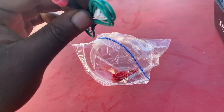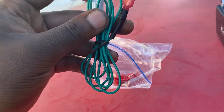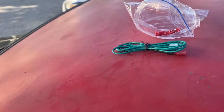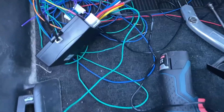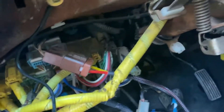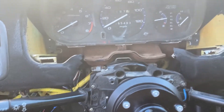There's no soldering. This kit does require just one splice connection, and this I believe is to the brake pedal switch — so you'll have to press the brake pedal to start the car, like a modern push-to-start car would be. We got that green wire finally hooked up to the brake switch. On the EK, it's gonna be a dark green wire way at the top. You can see I stripped back the wire a little bit — it's that dark green one at the very top of the brake pedal.